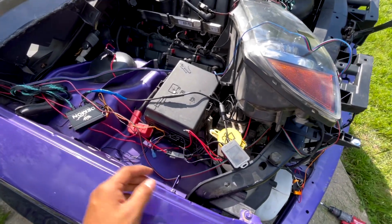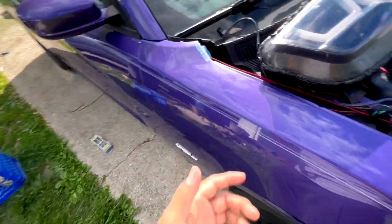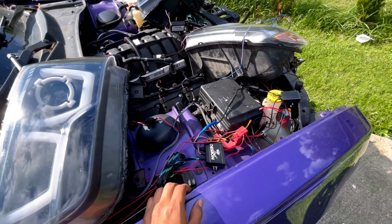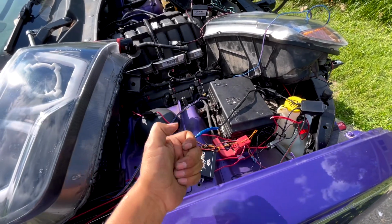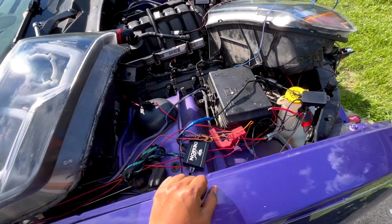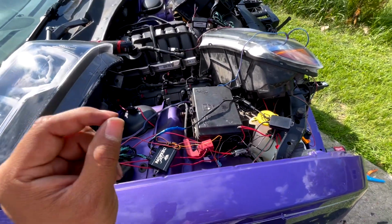They'll install it, you know, simple positive, negative, and assume it's ready to go, and you can just turn it off and turn it back on in the app, which is possible, but it's not going to last you a long time. That's why you want to do the switch. That way it's on when you want it and it's off when you don't want it. So like I said, don't connect directly to your battery. If you do, just do it to test it.